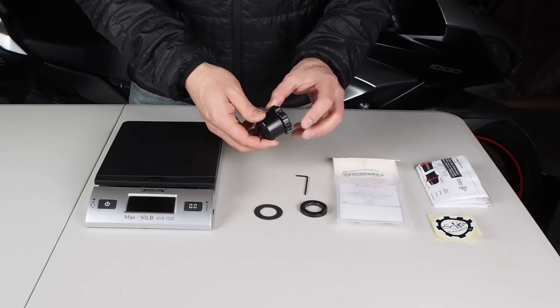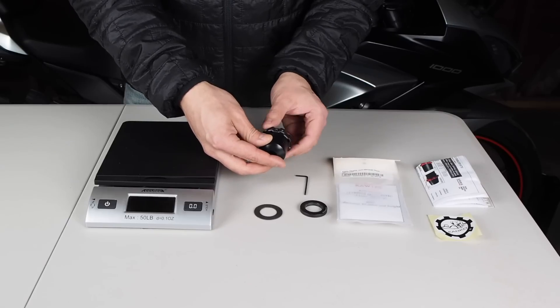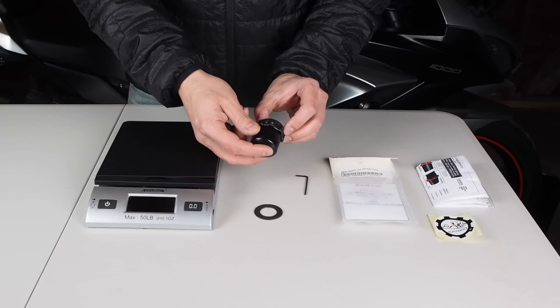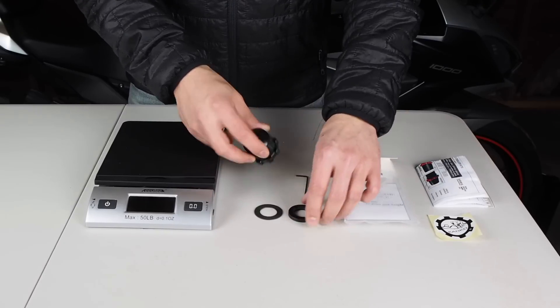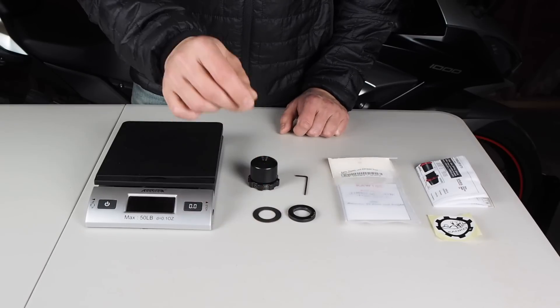You have this metal bar and weight and then a plastic ring. It's reverse threaded so that as you roll it backwards with the throttle, it moves inward a little bit. The spacer sits right here, and that's what presses on the throttle tube to create friction. They also give you an additional thin spacer just in case you need it, but you're not supposed to.